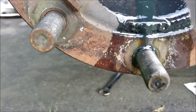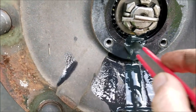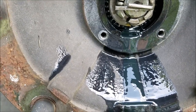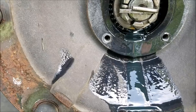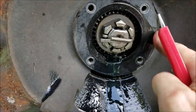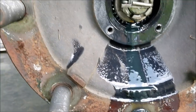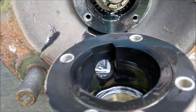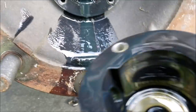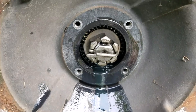Now more oil is coming out. That gasket was holding a lot of oil in there. So if you want to do a more thorough oil change, pull the cap off and cut a little notch. Or if you ever change the gaskets, cut a notch so the next time you do an oil change, the notch will line up with the notch in the cap and you'll get more oil drained out.